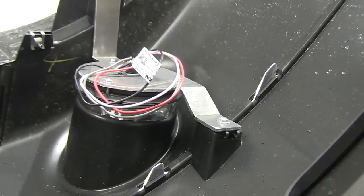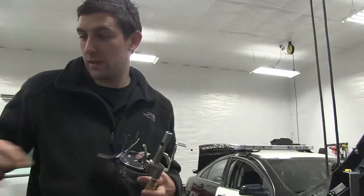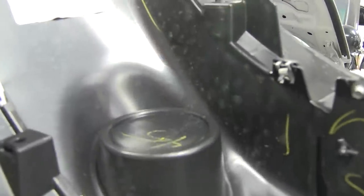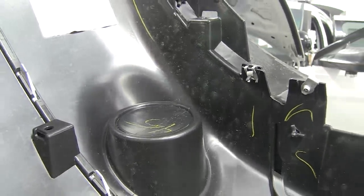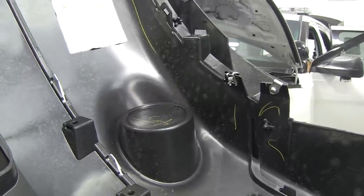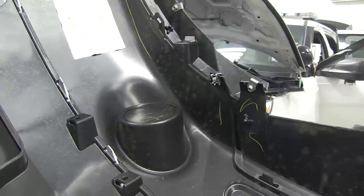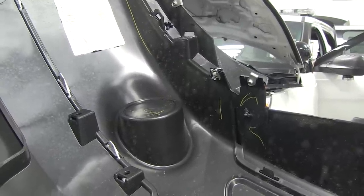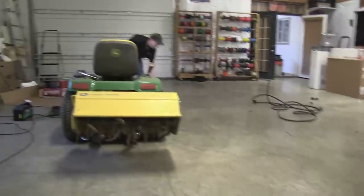You do have to drill it out though. First thing is to drill out the plug, then I made a bracket that uses what would be the factory fog light mounts. So again, like the grill lights, no holes are being drilled into the front bumper cover — just using what is given.